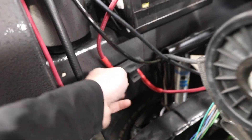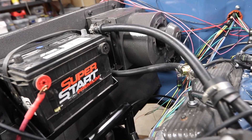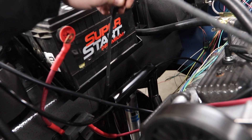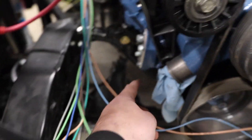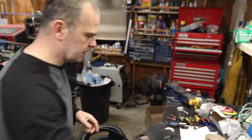It's the Bussman fuse that goes to the battery, and the one I was holding up is the starter motor — that'll go to the positive obviously. What I need to do now is the chassis ground, so I'm going to go from here. The battery ground goes from here down to the engine block.